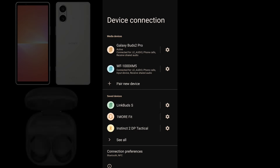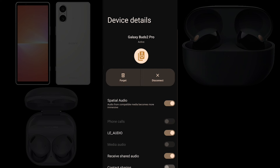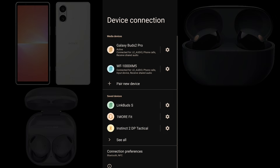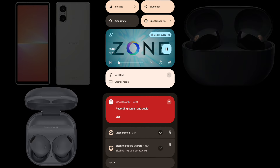We have an Xperia 5 Mark V running Android 13, connected to Galaxy Buds 2 Pro and WF-1000XM5s using LE Audio simultaneously. In device details, the Galaxy Buds 2 Pro have LE Audio turned on as well as Receive Shared Audio, which is required for joining a broadcast. The WF-1000XM5s also have both features turned on. Currently the Galaxy Buds 2 Pro are active — tap the play icon and the music comes out from the active earbuds.